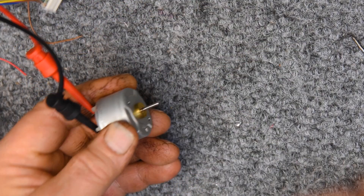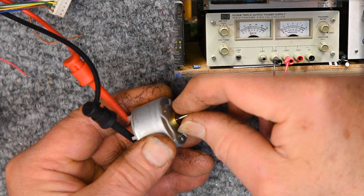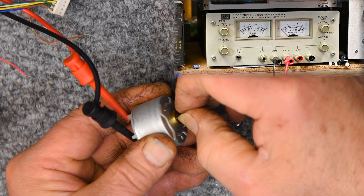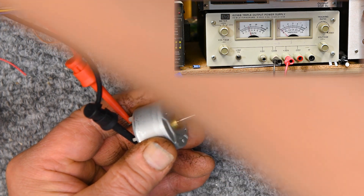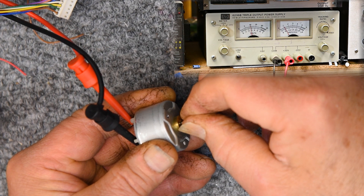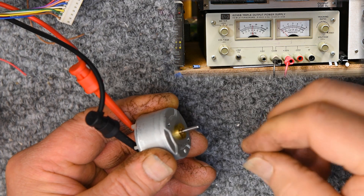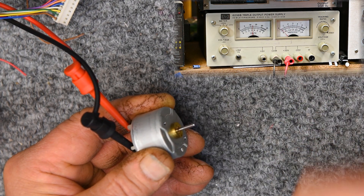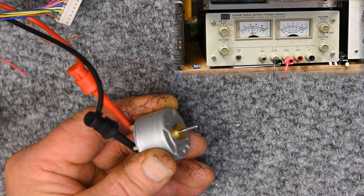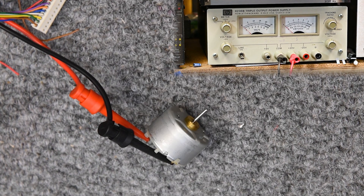Let's pay attention to the numbers now. Got eight volts on it, it's pulling about 100 to 200 milliamp loading it reasonably. Trying to stall it — I really can't. 10 volts. I'm putting a pretty good amount of load on it and squeezing hard trying to stall it — cannot stall it. Even cleaning my hands I can't stall it. I would have to use a piece of leather or some saddle rosin. I'm pretty happy with the way that turned out, and we'll move on to the rest of the project. Thank you for watching.